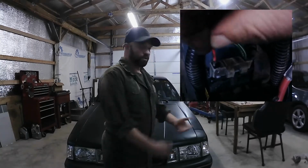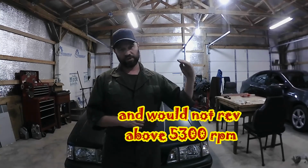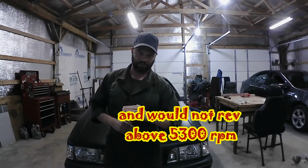That's just some good checks that I've done on my Fox Mustang. Looking good, driving good, enjoying it. I know that this is kind of a more boring-ish video, but I did show you the coil wire thing, right? So that's something that'll come up and get you if you're having that trouble. That's where you're cruising along at a good power level, and it drops down for a little bit and comes back up. That's what it was doing, and that's one of the telltale signs.